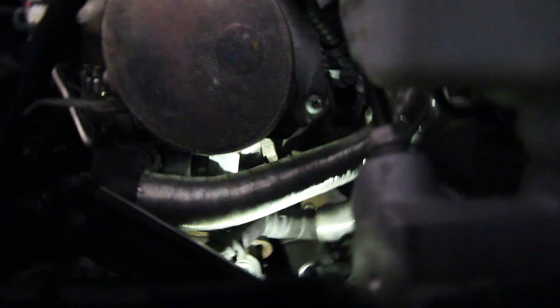This part's going to be a little bit difficult to film, but you're going to want to stick your hand down in between — I believe this is the block right here — and basically put your hand in between the heater core hoses. Go down in between them and you can kind of feel the wastegate rod on the left side of the down pipe flange. It's a little finicky, but go in there once your engine is cool — do not do this while your engine's hot or you're going to burn yourself.